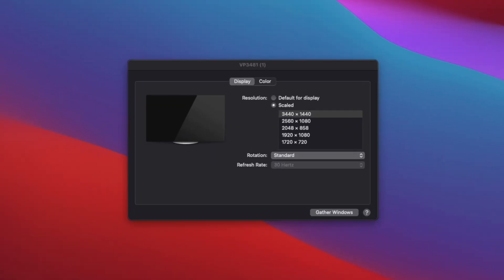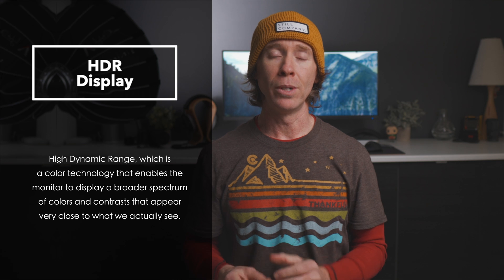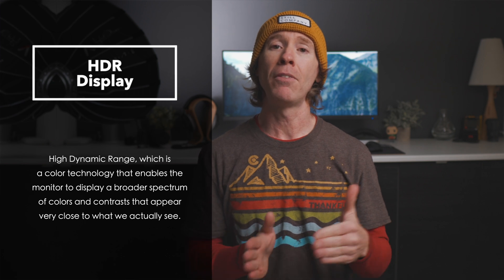One of the things I needed to clarify is that when I did testing with the HDMI cable, I was actually getting a 30 Hz refresh rate. However, here is the disclaimer: if you have a monitor capable of HDR — high dynamic range — you should be able to go into your monitor settings, enable that, and then coming out HDMI from the Mac mini, you should be able to get 60 Hz refresh rate. That is something I wanted to correct and clarify.